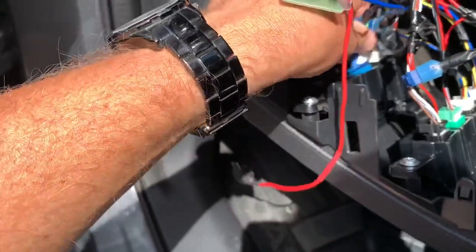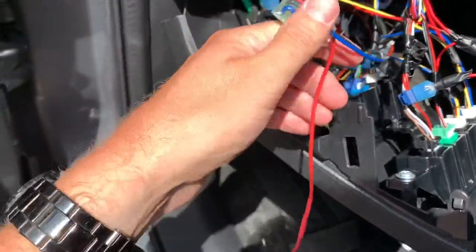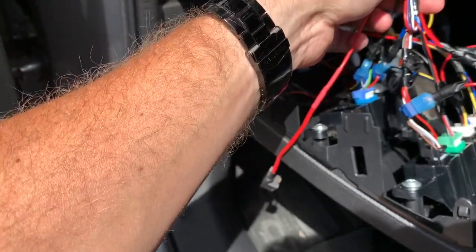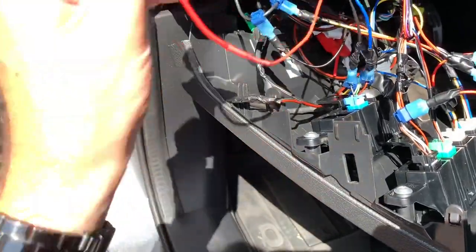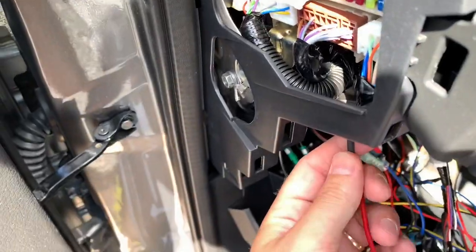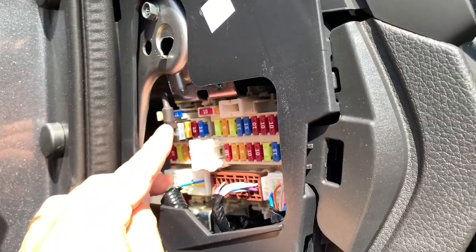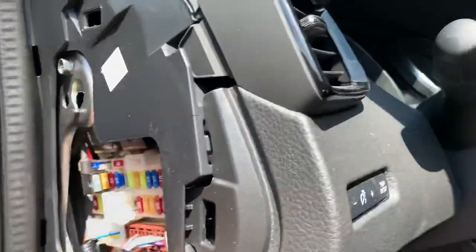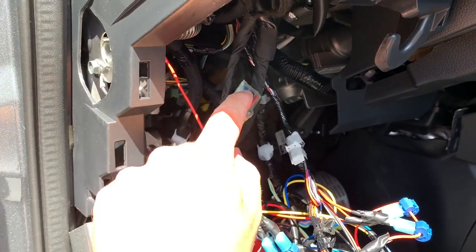So now we can put it back in place, like this. I will use some tape to attach the module to this cable harness, and we can put the piggyback fuse in. The piggyback is placed correctly with the draw side on the correct side, the cable is going down there, and I've taped it a little bit to take the stress out of the module.